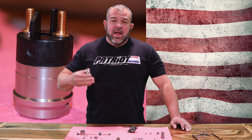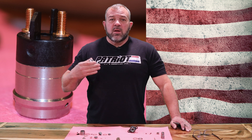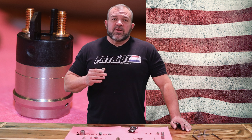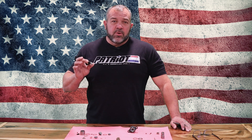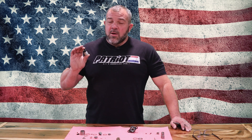As long as the injector stays clean and the armature lift is set correctly when installed, they last basically forever. If the injector gets dirty and starts to function slowly, the solenoid has to work extra long and extra hard and you'll destroy solenoids because of that. If the gap is set incorrectly, you'll actually ground these solenoids out and they will fail from that. Otherwise you don't really see magnets fail.